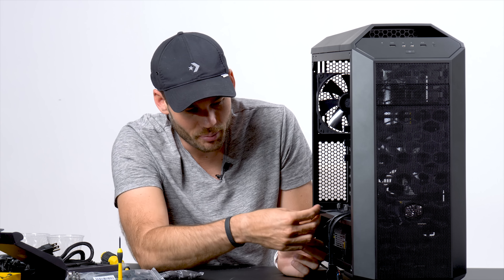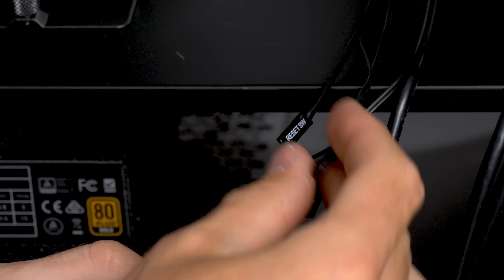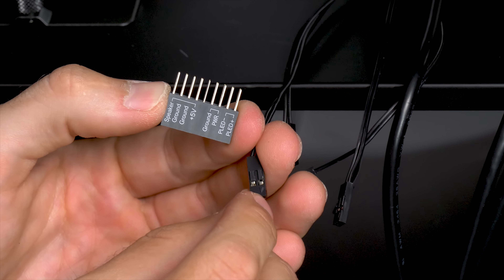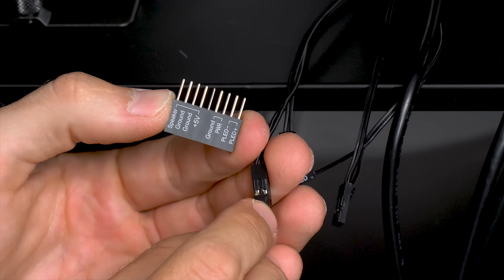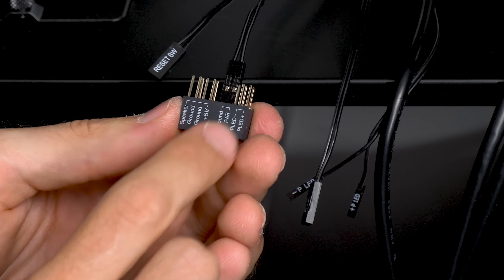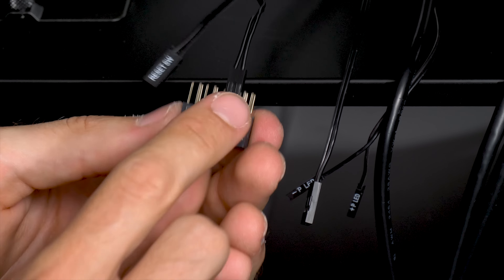The first thing you need to decide on when you're building a PC is what processor you want. I've chosen the Core i7-6850K. The K means that it is unlocked and you can overclock it if you want to — I personally am not going to be going that deep with this build. The reason I chose this processor in particular is because it's a six core chip. I've done a lot of reading online about what works best in Adobe Premiere, and apparently Adobe Premiere can take advantage of the extra cores, so this is one of the top processors for Adobe Premiere.